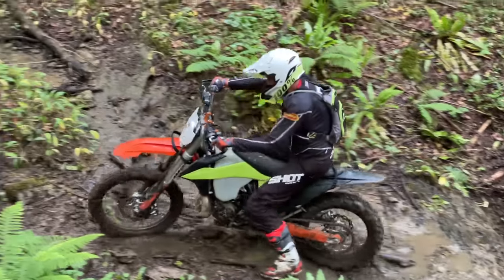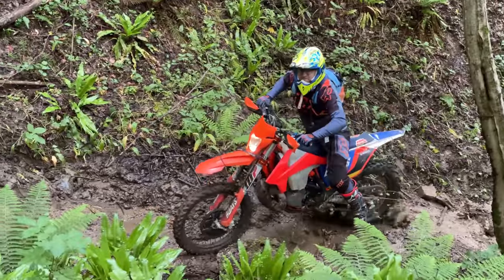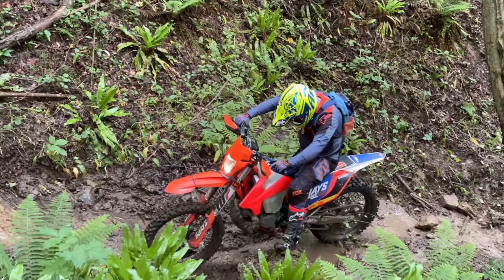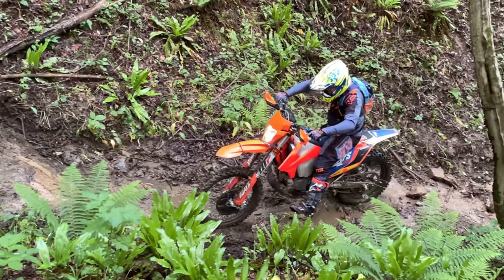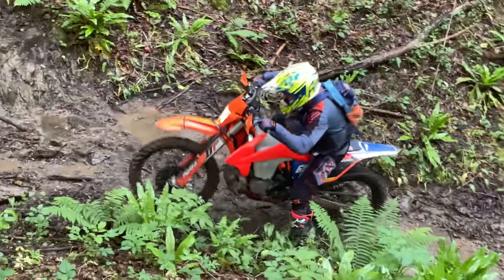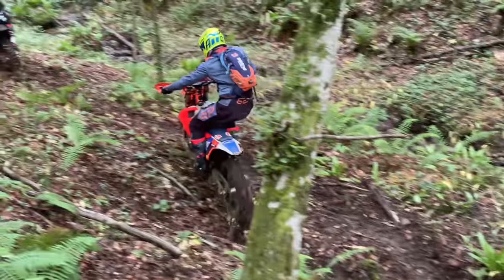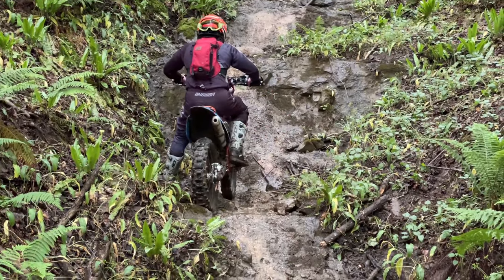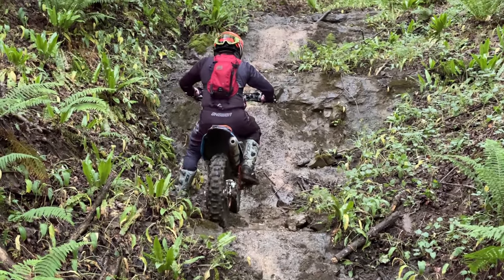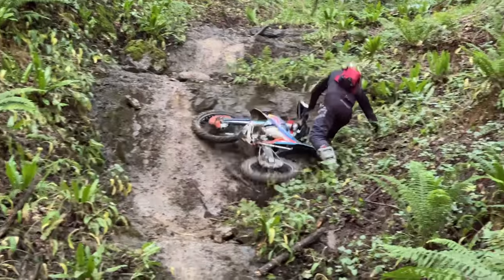Now that we've covered all systems and their pros and cons, what is best for you? Tubes are certainly the cheapest solution, but they are not good if you need to ride at low pressure — you will have a lot of problems with flat tires and you will lose motivation for enduro. Tubes can work really well on the front wheel, but forget they exist for the rear wheel. Invest money in a better system. Tubeless is a good system for almost everything: it protects your rim, you can use low tire pressures, and it is easy to patch the tire if you puncture it in the woods.